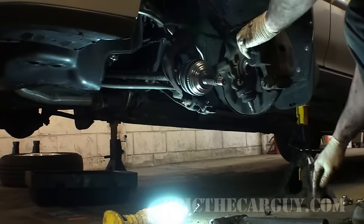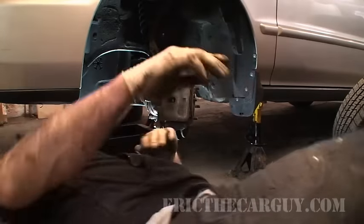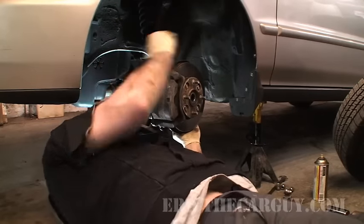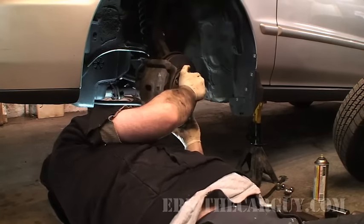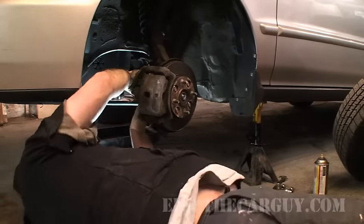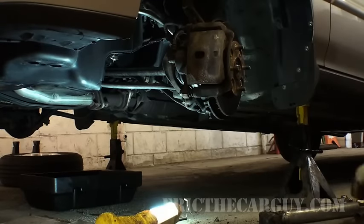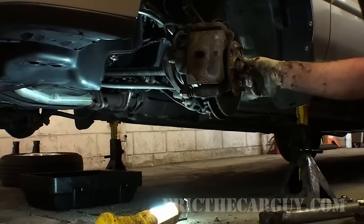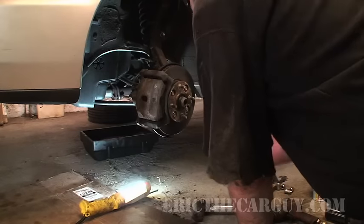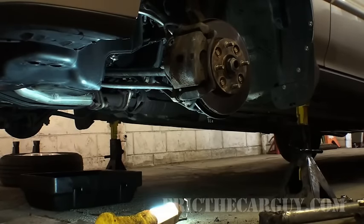Get your bungee cord — it's much easier to do at the right angle. Feed your axle back through. Turn the hub until the splines start filling in. Take your ball joint and slip it back in. As long as you've got a couple of threads sticking out, you're good. Tighten it down. Put your wheel back on — you just replaced an axle.